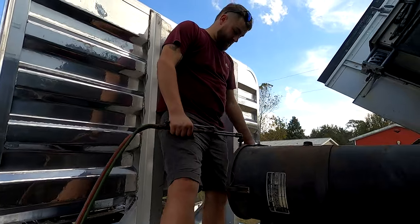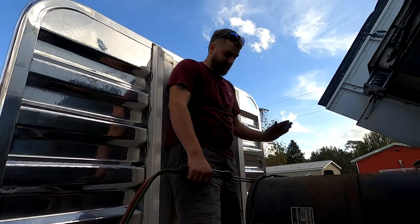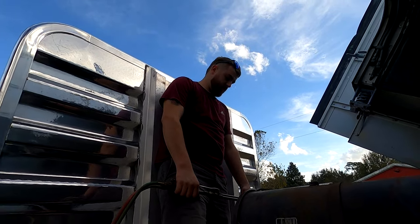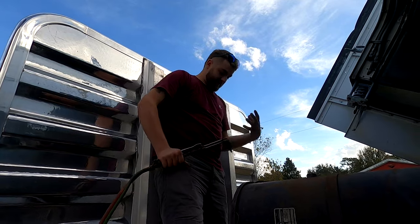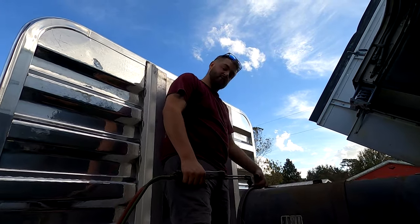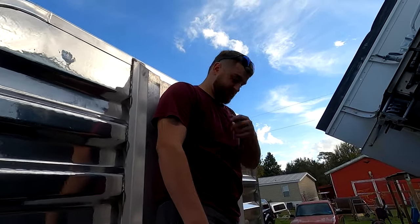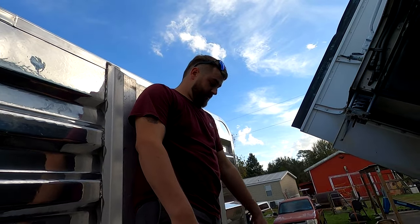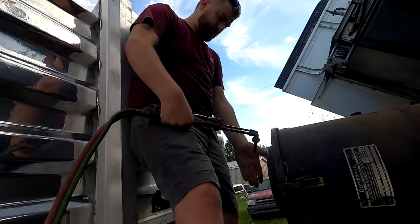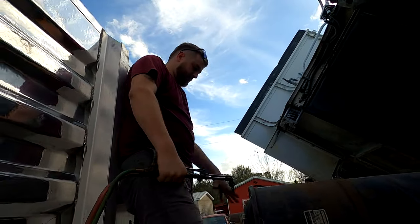So everyone, I've got the battery box back bolts unbolted, but the front are rusted out, probably from battery acid and stuff like that. And this battery box is actually made out of aluminum. So instead of completely removing this one and only, we are gonna get the other battery box put underneath the headache rack, and it only holds two batteries. So instead of only having two batteries, we're gonna cut this one about 2/3 of the way in half, so we can run our exhaust through here. Then we're gonna run two batteries right here.